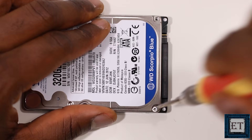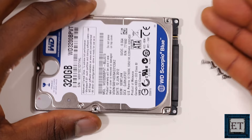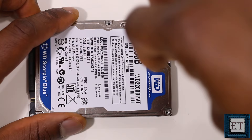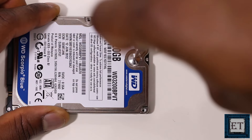Now, speaking of the possible causes of this problem, there are several likely reasons why this would happen. The most common one is the static friction effect. This phenomenon is called stiction, which is basically when the disk head gets stuck to the platter as it tries to return to the landing zone. The chances of this are usually higher for systems that run non-stop, like servers.